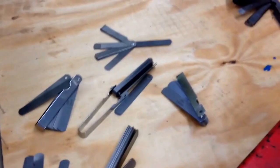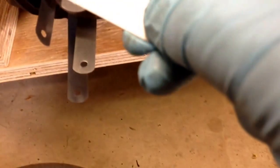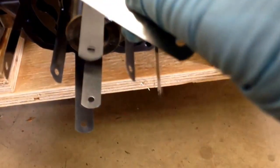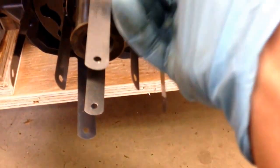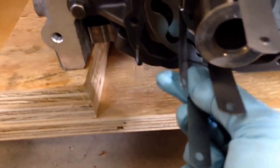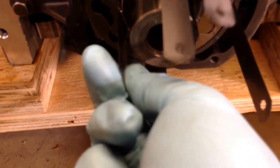This is the ridiculous part — this is how you know if you're hardcore or not: how many feeler gauge sets you got. On the inside here, managed to get 6 thou. And then on the outside between the rotor and the oil pump housing, we got a 3 thou measurement. So this pretty much goes in all the way around. I went with 4, 4 around each one on this one. In the book it says 3, but whatever — I got the feeler gauges, may as well use them. So pretty even all the way around.